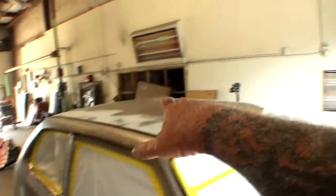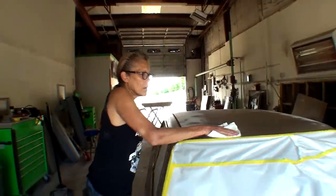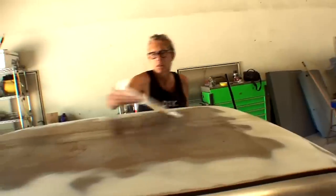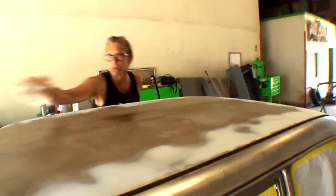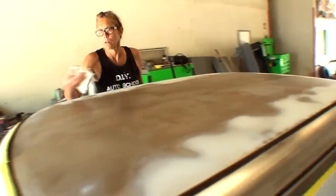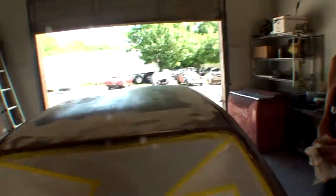What we're doing is we are cleaning the metal off, because this car has been sitting for how many months? Months. So what we're doing, we're using regular rubbing alcohol. Mindy's wiping everything down. She's even wiping the Bondo, getting all the dirt and imperfections out, and then what we'll do is be primer ready.